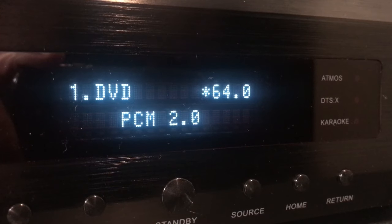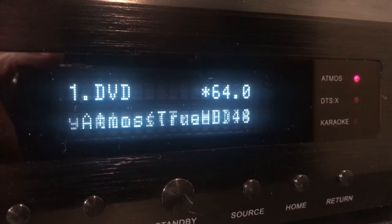I did three things right off the bat. The first was connecting a video monitor — there are multiple HDMI outs, I just used one, connected an HDMI cable to the monitor. That's all I had to do, but it's necessary so you can navigate the menus. The second thing I did was use the monitor and remote control that came with the AVR to configure the output for speakers to 5.1.4. And the third thing was connecting a Blu-ray player to one of the HDMI inputs — all it took was one HDMI cable. Super easy.